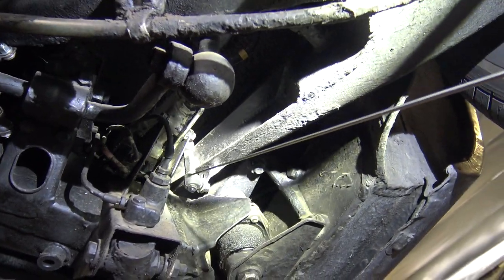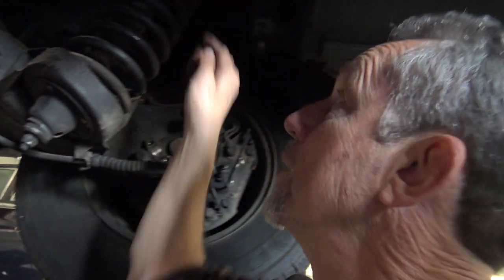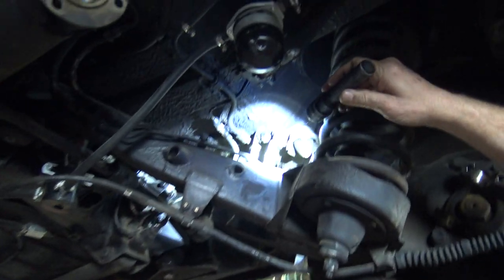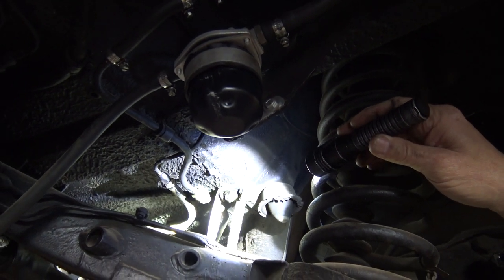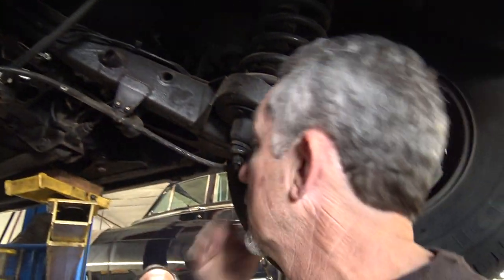These activate this, put pressure on top of the ram. When you bleed them, you actually disconnect this linkage, activate it, and you watch that spring compress. It's a little dangerous, a little scary. They have a strap right here — you see the strap bolted to the body? It's got grease on it, that's called a rebound strap. On some of these older rusty cars they can fail. I had that happen to me once — I was bleeding a car right here, that thing failed, it came down and knocked me down.